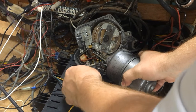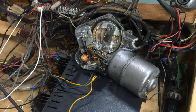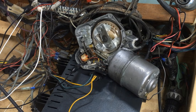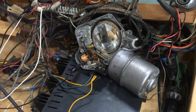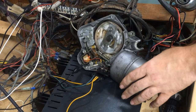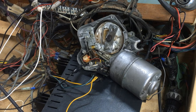I've cleaned all the grease out and I'm putting white lithium grease in and packing it well so that the motor is well lubricated. Now I'm going to put it back on my test stand and see if it will work this time. There is low speed going around and around and around. There is high speed making a little bit of noise — I'm going to move it around to quiet that down because some things are probably up against the wiring. And I've told it to park: the pawl comes out and it works just like it should. It was running in reverse.